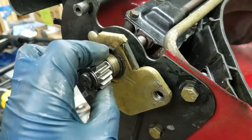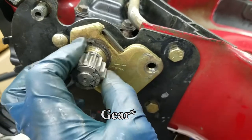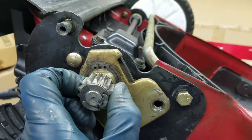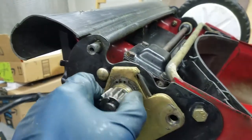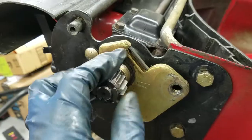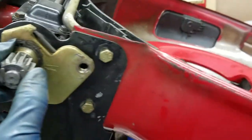The last thing would be that the grease in these clutches probably got so hard that the key actually stopped grabbing the pulley very well - maybe it skips because it's stuck down. When I took these apart, the spring that's in there was actually kind of stuck because the grease was just so dry. It probably wasn't too far away from actually having problems, but a little bit of cleaning first and a little bit of grease and they work like new again. I chose silicone paste because it's really good at keeping water out, and I do wash my mower a lot.